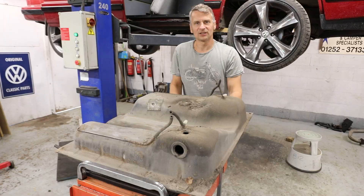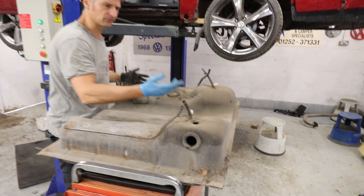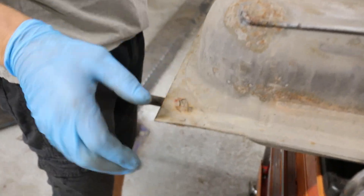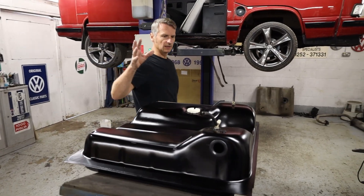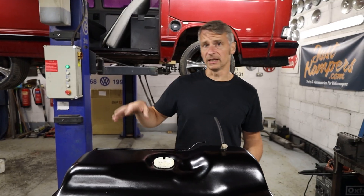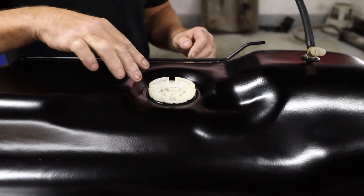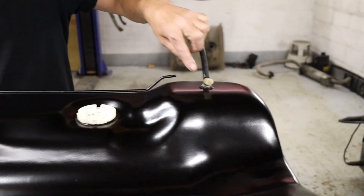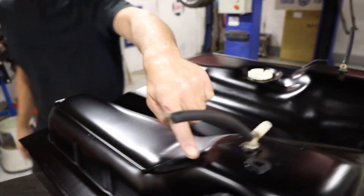There we go — one very old and crusty diesel fuel tank. As you can see there's a lot of debris on top. These collect a lot of dirt and crud on top and that causes them to rot out — as you can see it's started to rot out in the corner here. So this is our brand new fuel injection tank. We've waxed the top to protect it from moisture, and underneath I've stone chipped it and will wax it again once it's in the vehicle. I took the sender unit out of the original tank, tested it with a multimeter — that works fine — and fitted it here with a new seal. New seals for the breathers as well, and a new seal for the filler neck.